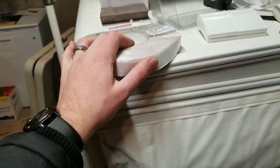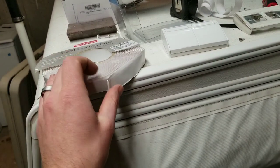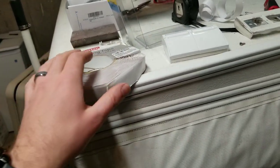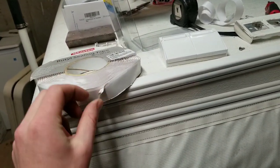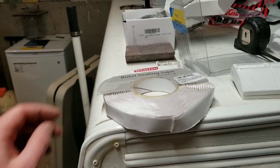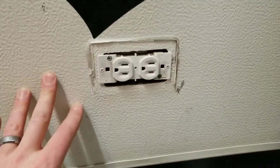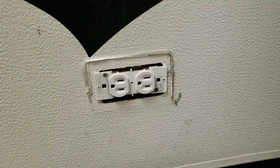It's fairly inexpensive — about $20 for 30 feet. So I'm going to use this to seal the back of the new cover. The nice thing about butyl tape is you can remove a component without having to replace the gasket; it just peels off, you buy some more, stick it on, and it's not a huge cleaning effort. It's water and airtight — just clean the surfaces and it sticks really well. You can see the old cover had silicone or caulk along just the upper edge, probably from the factory.